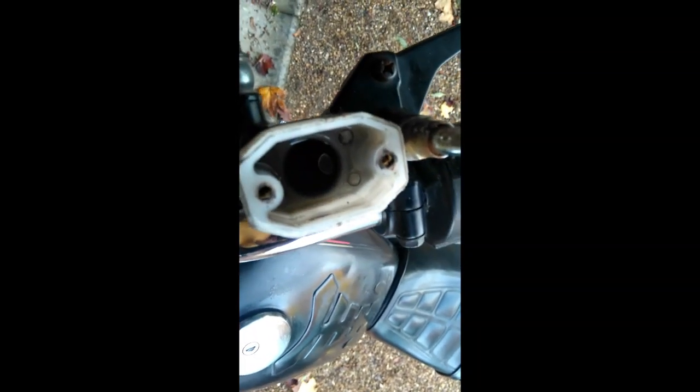As we can see, the level is incredibly low. Now it could be for two reasons: it could be the pads have worn, so all the fluid has gone down through the pistons, or it could just be low. So I'm going to top up with a little bit. It's also very dirty, which is a bit of a worry.